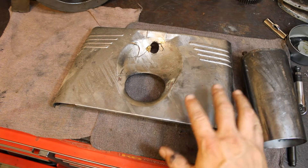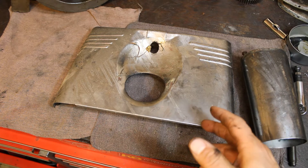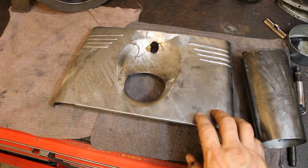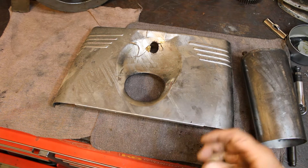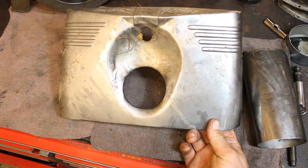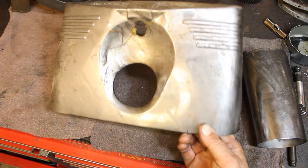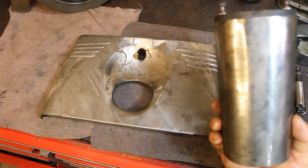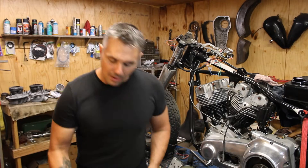It's kind of a good thing they're stainless, because if they had been chrome they would have been more prone to corrosion after the fire given how hot they got. Chrome also peels when you try to buff it on a high-powered buffing wheel. Being stainless, I can make both of these look brand new again. Let's take a look at the triple trees.